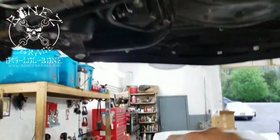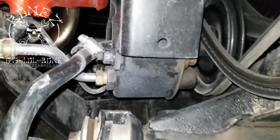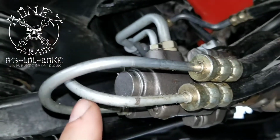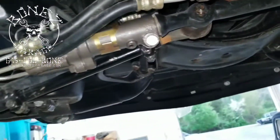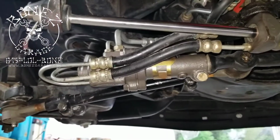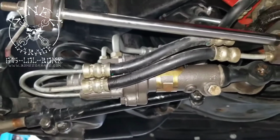That's all the power. And it comes from the power steering pump, which in these cars, you can see is right there. That's the power steering pump. So you got these lines, which come out around. They go into here. Then they come through here, go into these lines, and then through these lines into this power ram. So there's so many lines, there's so many extra connections, there's so many extra parts, extra gaskets, extra everything, and they leak. And you lose feel of the road. I don't like them. I think they should all be changed. Everybody, if you have a Corvette, change it.